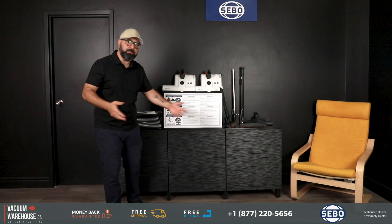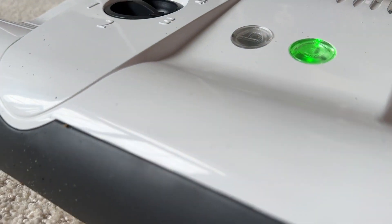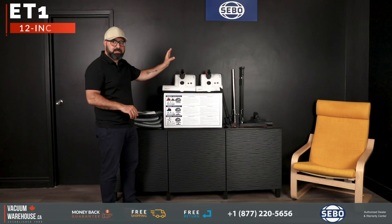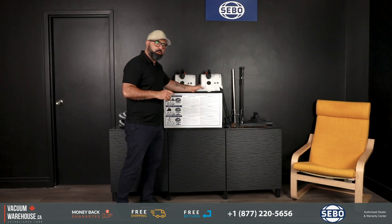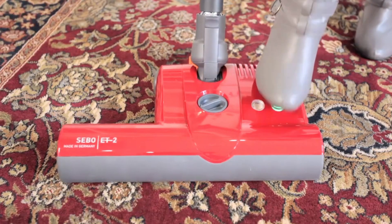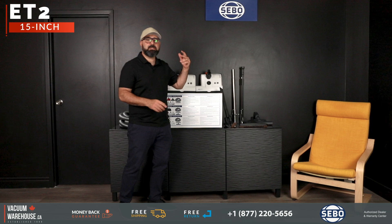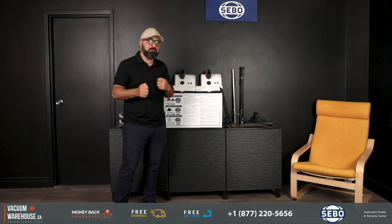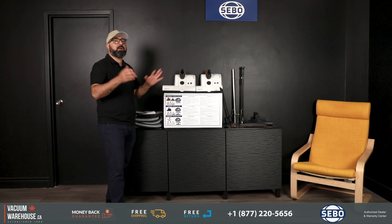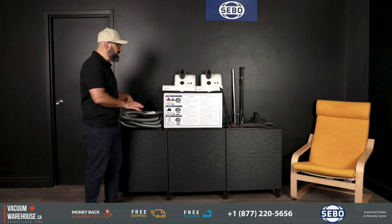So you have carpeting. Now there are two different major variations: you get them with an ET1 floor head or an ET2. They're essentially exactly the same thing except the ET1 has a 12-inch path and the ET2 has a 15-inch path. For a regular home with regular obstacles on the floor, the ET1 is always easier — a little lighter but much more maneuverable around and underneath things. The ET2 does great with large carpeted unobstructed areas.